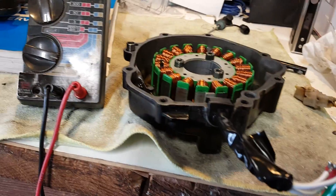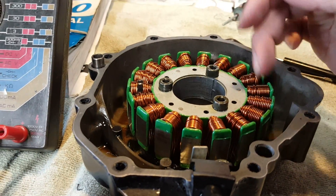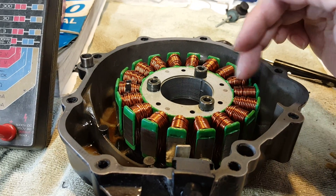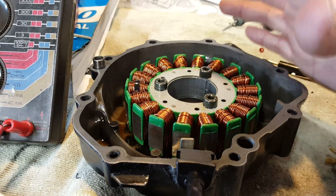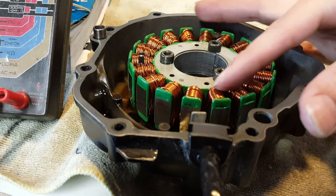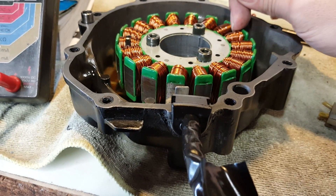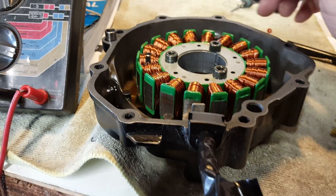The only reason I opened it up is because after seeing this issue I wanted to check if any of my coil windings were burnt. If you do happen to crack yours open and you're experiencing an issue, go ahead and take a look at the coil windings — if you see any of them black or burnt, chances are the stator is bad. So if you crack it open and see all kinds of black on what should be nice shiny brownish tin-colored coils, go ahead and replace it, because it's probably bad and you've got an electrical issue affecting the voltage output.